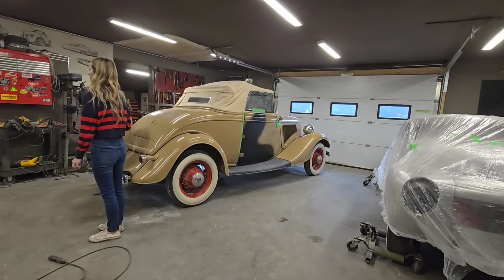You'll find, when I've painted a few cars in my day, the ones where I've welded the fenders on and got the quarter panel here, when you spray here, the overspray goes over there and dries that fender out. And then when you go to spray that fender there, the material goes over there and dries that area. It's a hard process. You're almost better off to paint one side and tape the other side and try to bring it together, I guess.